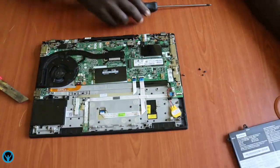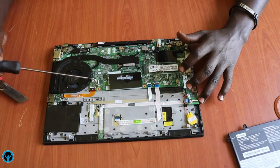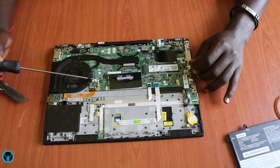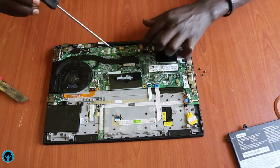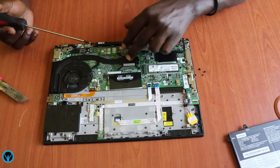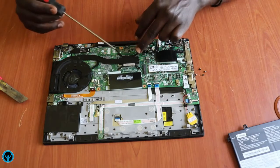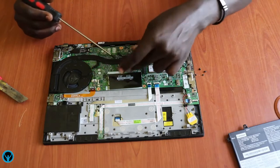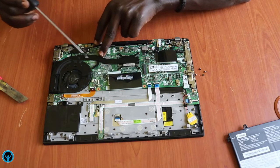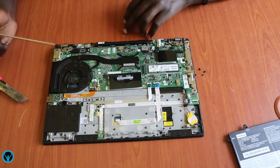Focusing on this area, here is the fan and its connection point is right in this corner. In case we want to remove the fan, we first disconnect it, then remove the heat sink which covers the processor. It has five screws holding it: four around the processor just below the heat sink, and one that holds the air pipe. The fan sits here as well.